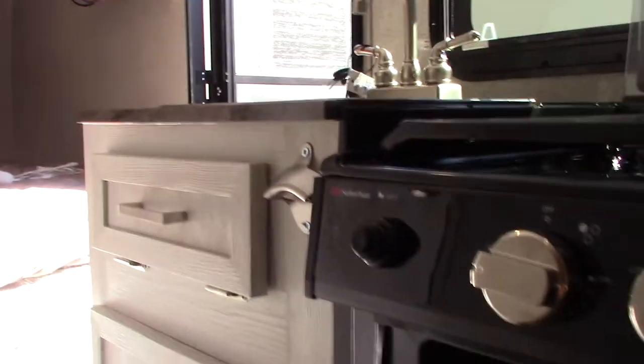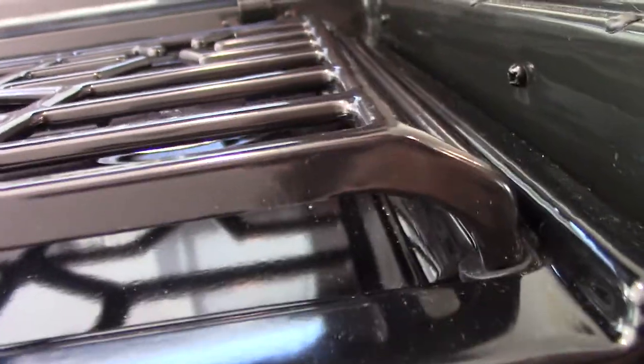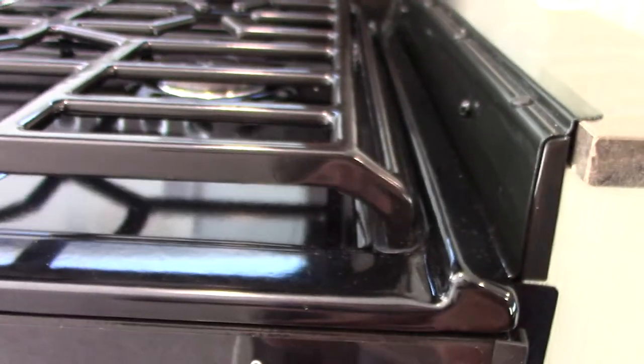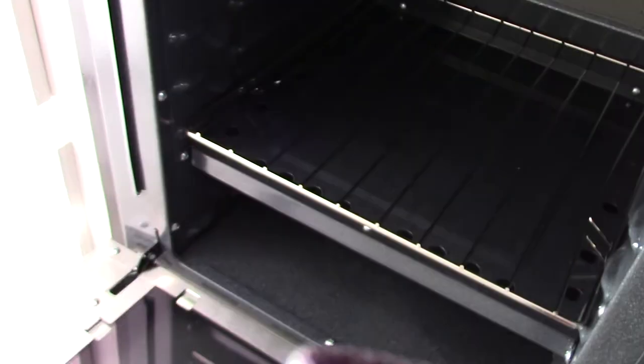To light the oven, it's a little different. Way down here there's a pilot light all the way to the back, so you have to light the pilot light. You'd take the oven knob, go to pilot, depress it and hold it in, then light the pilot light. After it lights, still hold it in for another 10 seconds or so to heat up the thermocouple. Then go to operating temperature and it cycles on and off as an oven does. When you shut it off, the flame and pilot light both go out, so you have to relight the pilot each time you use the oven.